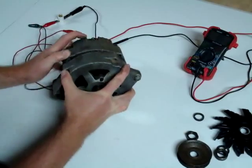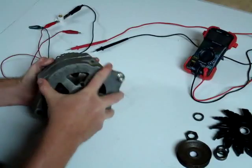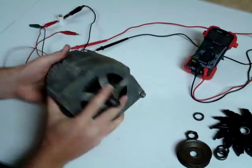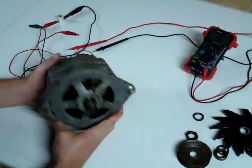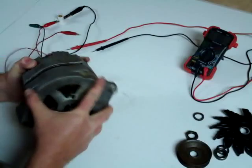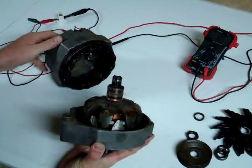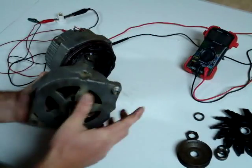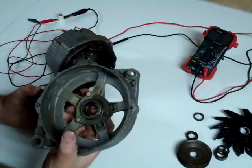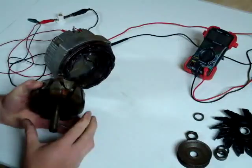You can see as I take this front cover off — I've taken all the bolts off to remove the cover. There are four bolts that normally come in through the back. You can see based on all the wires coming out that I've already been doing a little bit with it. I'm going to take this front cover off, and out came the rotor. The rotor just slipped out of the front cover, and there's a little bearing inside that the rotor turns on.